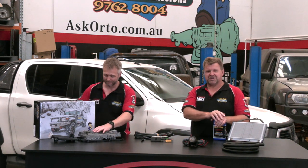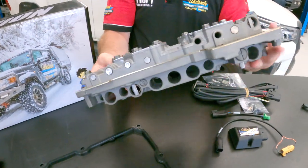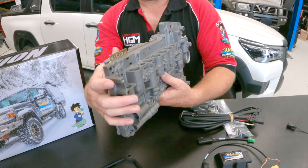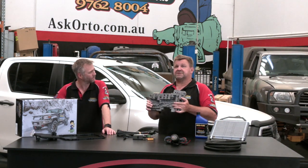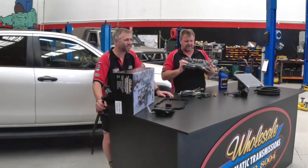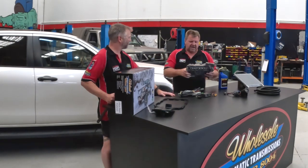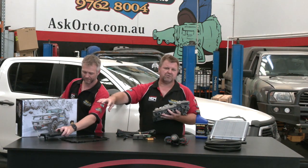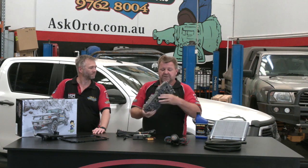Let's kick things off with probably the one we're best known for: the Nomad Valve Body. This is what we call an AC60 valve body. It's the same valve body that we design and build — a Nomad valve body that we build for the 2.8 Hilux. We also build it for the 2.8 Prado 150, the Fortuner, the current D-Max, the current Mazda BT-50 (the three-litre), and we believe it's in the Tacoma in America and one of the Suzuki Sierras as well. It's a heavy-duty Nomad valve body, built as a complete kit — comes with all new pan gaskets, the oil filter, and any O-rings you need for the oil filter or between the valve body and the transmission.